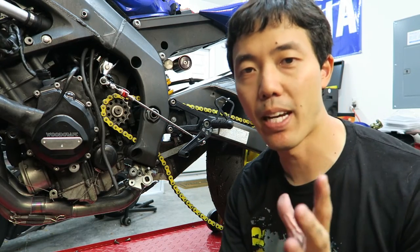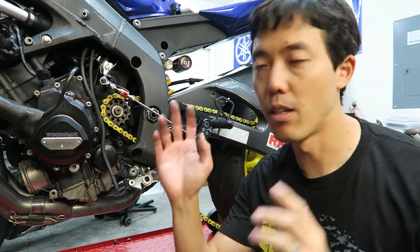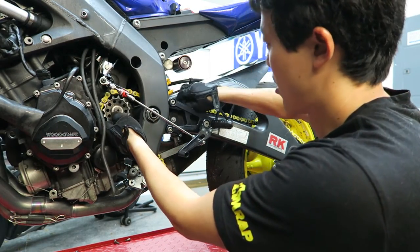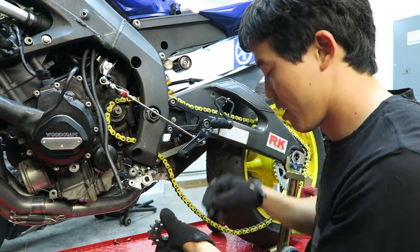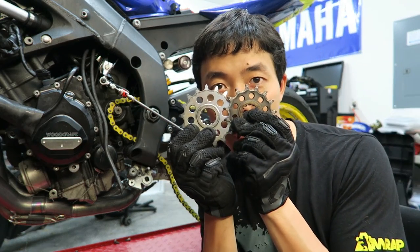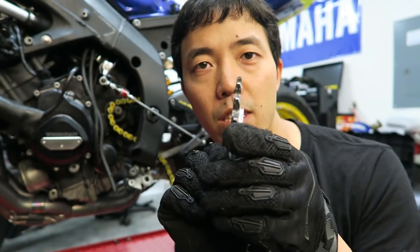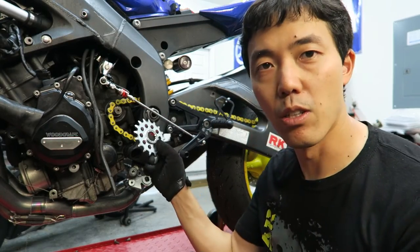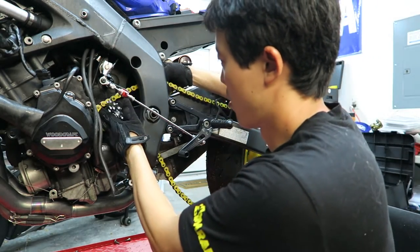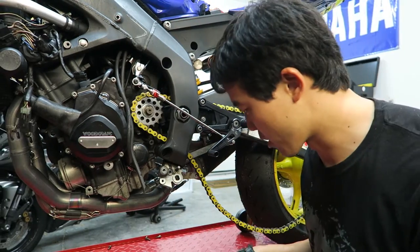I think you can make an impact with a torque sensor in it, so that when you torque it down you can set it and just torque it down — that would be absolutely amazing. This should come straight out, just like that. Old sprocket, and a bigger sprocket. One thing to note: one side has more edge on it than the other, which is important because when you put it in there you want your chain to be aligned. I remember hearing that you always want the lettering out — let's give that a shot. Lettering out.